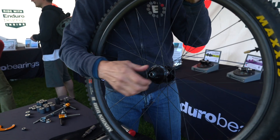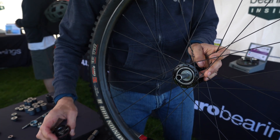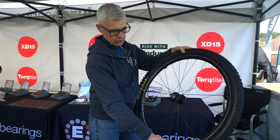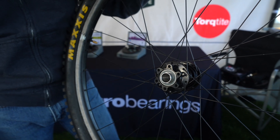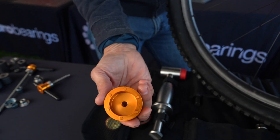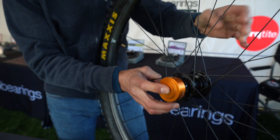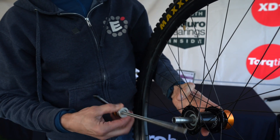With the caps out, it's easy just to slide that free hub body right out of there. The pawls — make sure the pawls all stay in place with the springs. You don't want to lose any of those, so I like to leave them just face up so nothing will fall out. So here we are: axle, bearing, bearing. Let's try removing this bearing by just pressing this axle out through the other side. To do that, I'm going to start with our BRT40 six bolt cup. You can see it's got little knobs there that fit into the six bolt interface precisely, so it keeps everything straight and lined up when we decide we're going to press that bearing through.